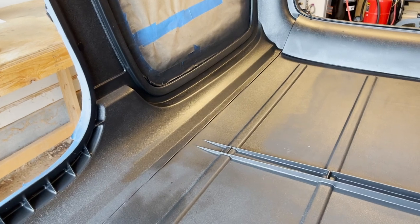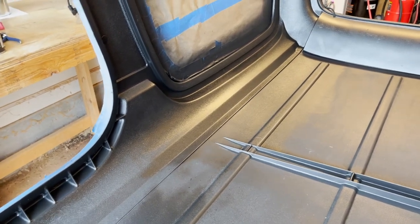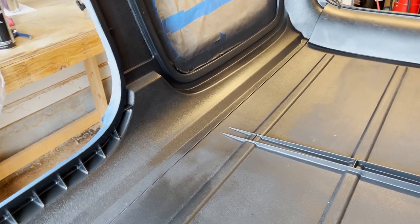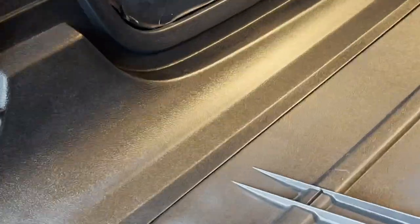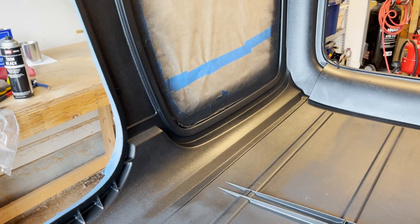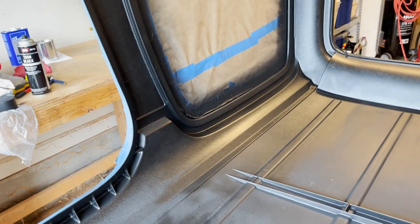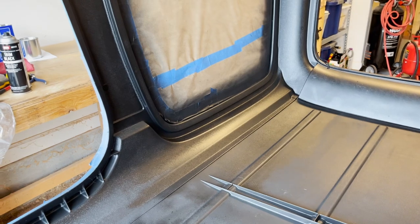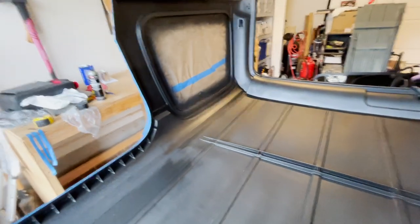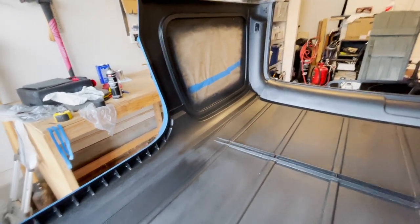As you can see earlier in the video, I'd spray the paint and it would roll down or pull down at the bottom of the window molding right there. So apply the heat, that gets it more tacky a little quicker. And it ended up actually minimizing the pulling to a pretty good extent. So that's done. The lacquer thinner may have helped just to get those initial light coats to stick. But I think the other main takeaway here is it just reemphasizes the importance of doing good prep. So make sure you scuff it up well, you clean the top with acetone very thoroughly, and hopefully you can avoid having that happen on your hard top as well.